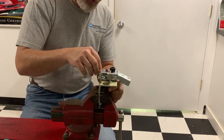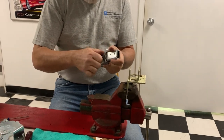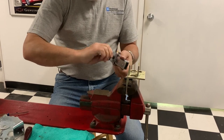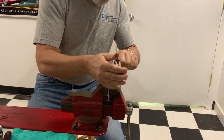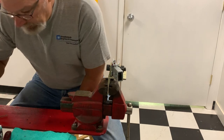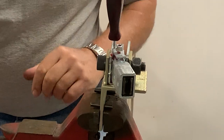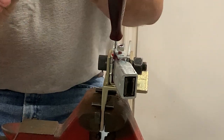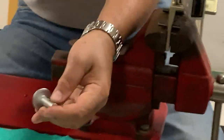The detent spring and plunger are in place, so now we've got to put in the selector pin and roll pins. To get the selector pin in, you've got to lever over everything and then it slides in. You've got your holes for your roll pins to go into, and you've got your new roll pins with the kit.